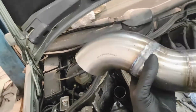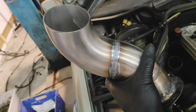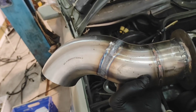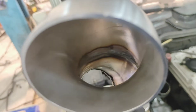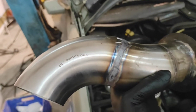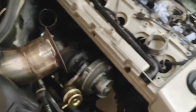The thing about doing the fusion weld — which I got from watching the Skid Factory — is that if you can't back purge, or don't have the finances to run two argon tanks for back purging, a nice fusion weld minimizes sugaring inside the pipe. You can see it's really minor — tiny tiny bits. As soon as you add filler, that sugaring increases massively and you're actually losing the internal diameter of the pipe.